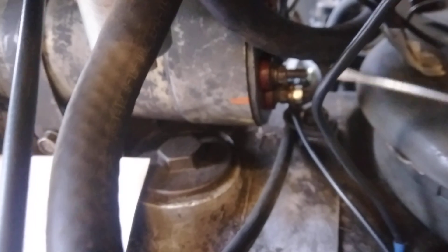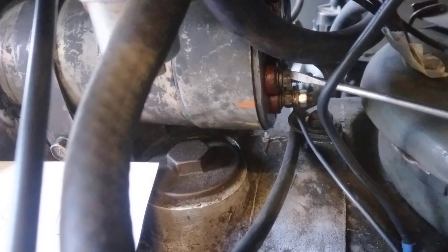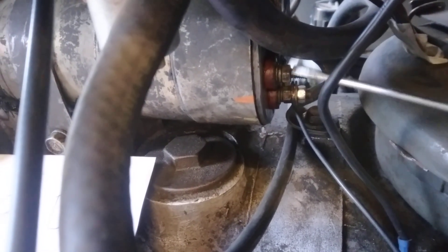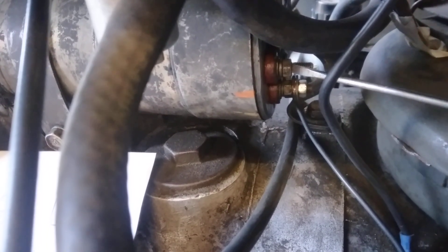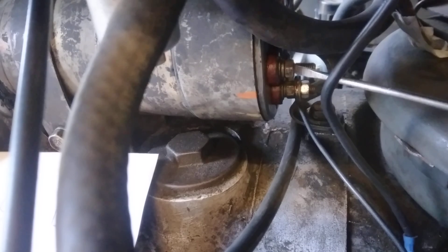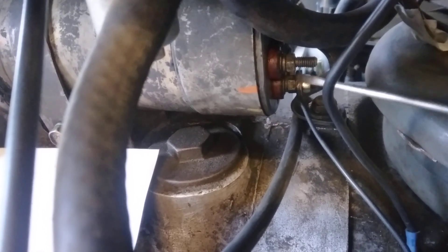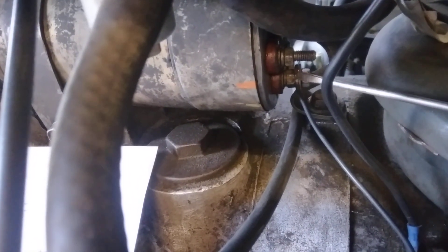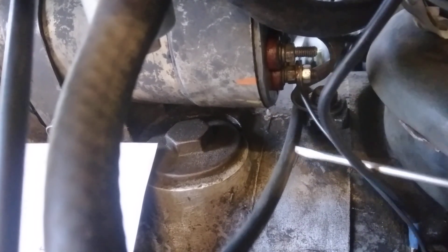I'm testing it on the bike. I've taken all the wires off — there they are, taped up out of the way. If this was a British dynamo, you'd put your voltmeter on the D terminal and flash it across to the field terminal to self-excite the dynamo. However, on Russian dynamos, they're regulated between the field terminal and earth.